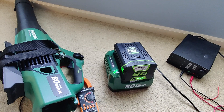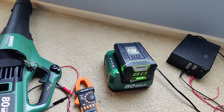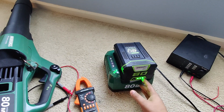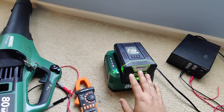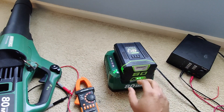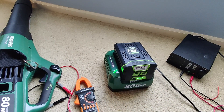There you go guys, as you can see it's working completely normal as it's supposed to. That means we've officially repaired this battery. It was not dead — it just wasn't going all the way full. The whole problem was half of the cells were not fully charged and half were fully charged, which was causing the BMS — the computer inside — to think the battery was fully charged when it really wasn't. We fixed the problem and here it's charging normally. If you like this video, please feel free to like, share, and subscribe.